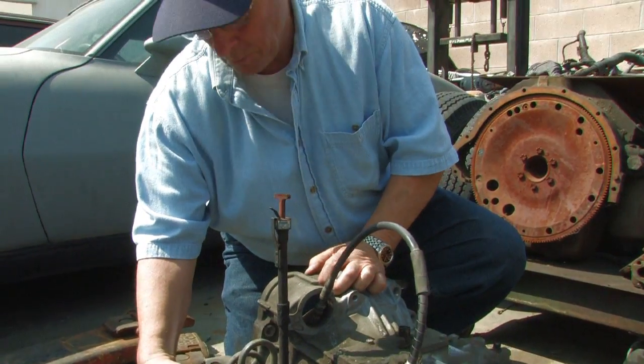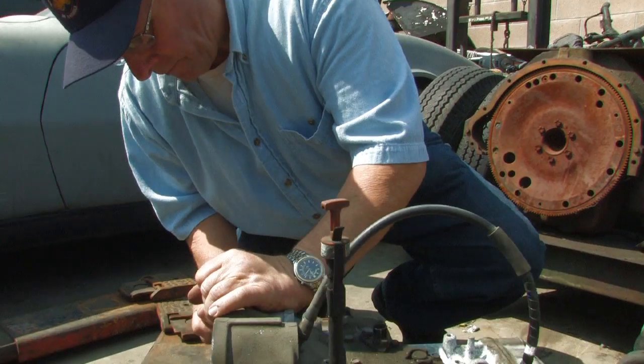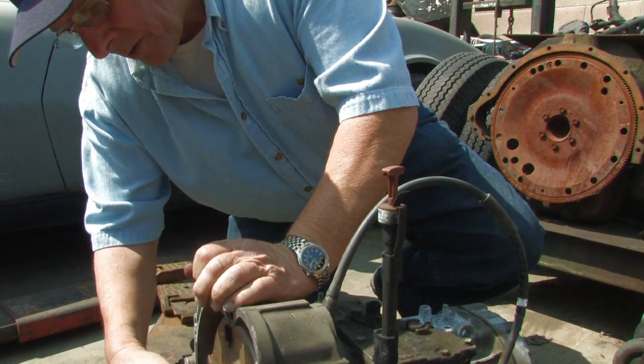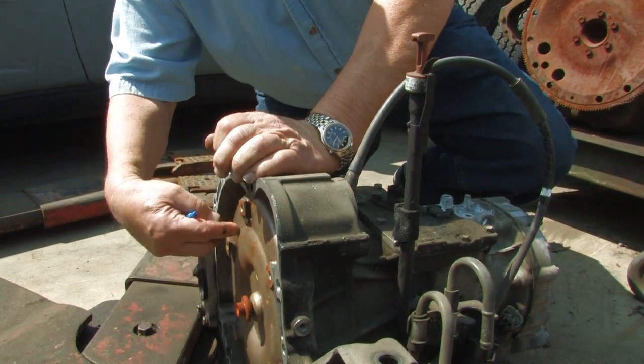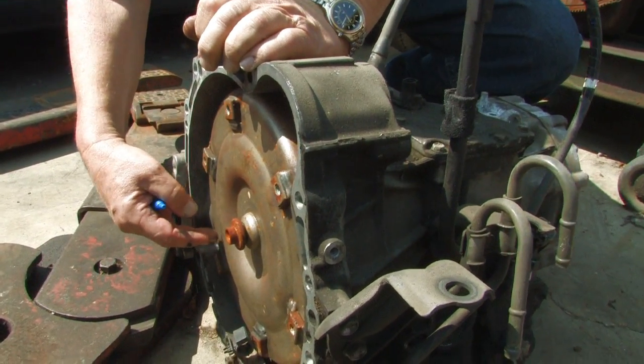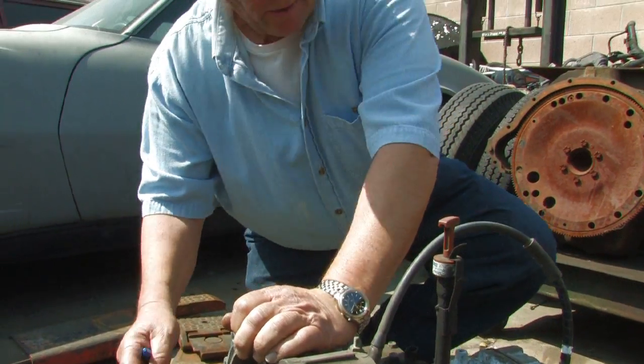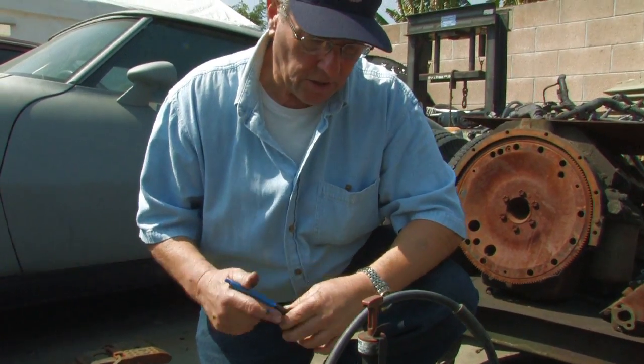These are some of your cooler lines that go out to your transmission oil cooler. The converter is actually mounted in this transmission right here — this is what multiplies the torque. This whole container, it's like a big drum, is actually filled with transmission fluid, and this is where a lot of heat is generated through this converter, and that heat has to be removed.